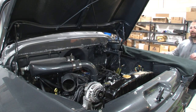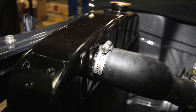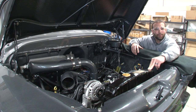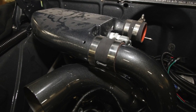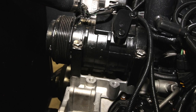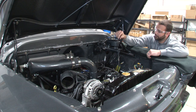Now topside on the truck, quite a few things have changed up front. We had a big four-core, extra-tall, extra-deep radiator built — it's a copper-and-brass unit, the old-style, because we want to keep the truck looking as original as possible rather than using aluminum. Our friends at WC Fab have done some work for us: the air-to-water intercooler is mostly plumbed, and we have our air inlet on the passenger side without the filter on it yet. The truck is also going to have air conditioning.